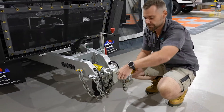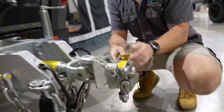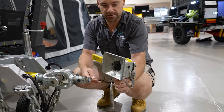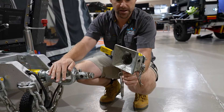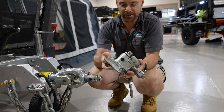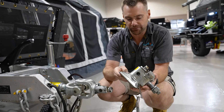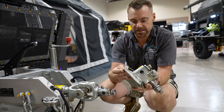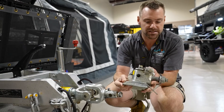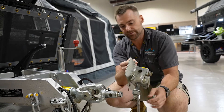Basically you've got two main parts that are part of this hitch. You've got the receiver, which is this part here, which I've actually just taken off the end here. This is the part that actually belongs on the car. You might be looking at it going, oh geez, what do I need for my car to work for that? Nothing more than a standard tow tongue. All that needs to happen is the ball needs to come off your tongue and this just gets placed on in reverse of it.